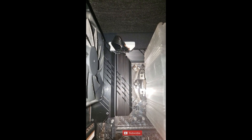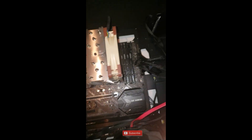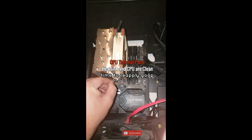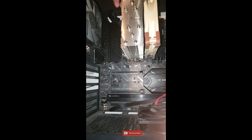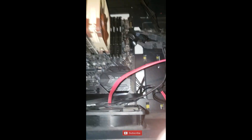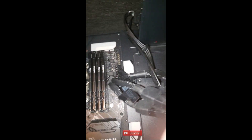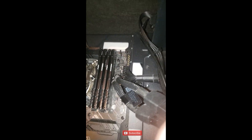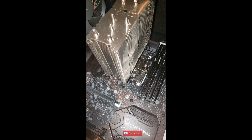One more important thing here about your computer. I've got the video card out and I'm going to use this opportunity - there's no dust which is a good thing - but I'm going to remove the clips from my fan on both sides. This is a Noctua heatsink and fan solution, which are the best in the market. Now I'm going to take off the entire heatsink by removing a couple of screws, because I want to re-goop my CPU.